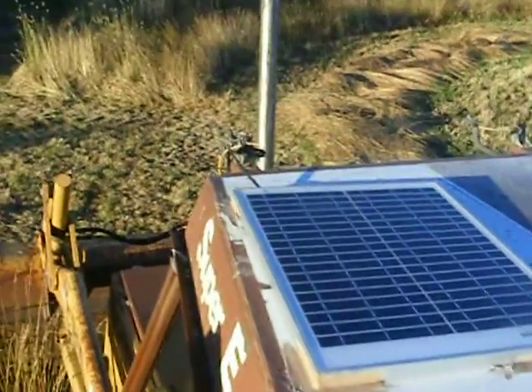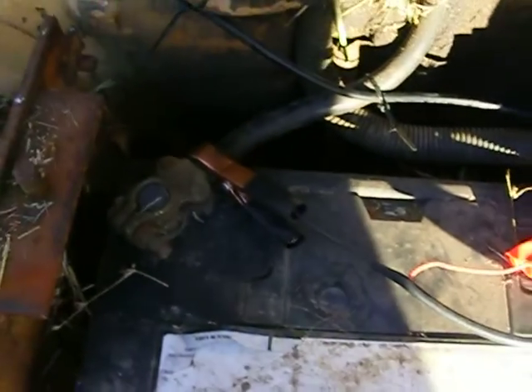So I put in that charger and I'll run a wire down the back there, you can see. I'll just show you how easy it was — it came with a regulator on it. I just plug in the back of that charger. The solar panel I put down there, cable tied it to the side there, and in under. There she hooks up with a couple of clamps, and you're done! How easy is that?